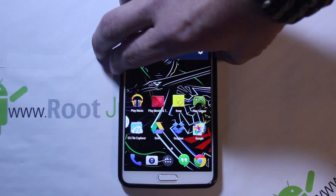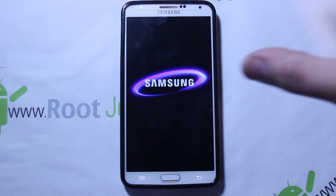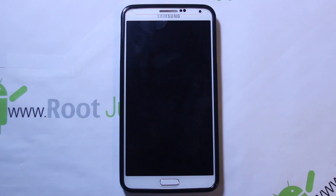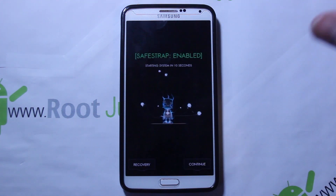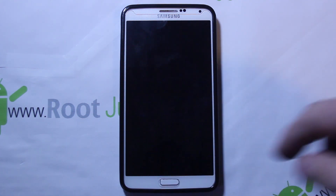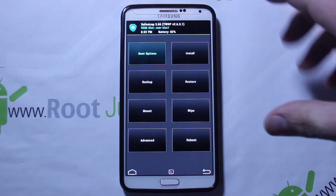I'm going to go ahead and reboot the device — just a normal restart. This will come up with the SafeStrap screen and you'll want to push the menu button to get into recovery. Anytime you have SafeStrap or root access, it's going to come up with this custom logo — it's not a big deal, don't worry about it. It doesn't void your warranty or anything like that, though if you wanted warranty service you'd want to restore to normal firmware. That should boot us into SafeStrap recovery — here it is.